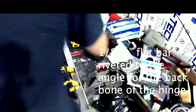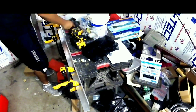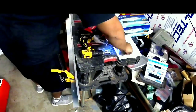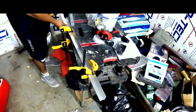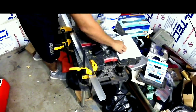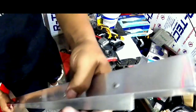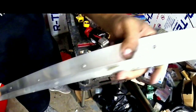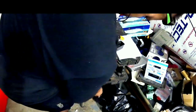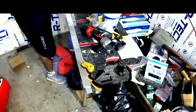Now we work on the hinge, which is its own big monstrous thing. I apologize for the giant mess in my garage — with limited time I have to choose between cleaning or cranking out this boat. Right now we're making the rod locker and side stow hinges. We're taking an inch and a half by one sixteenth angle and riveting a two inch by one eighth piece of flat bar to it. The one eighth inch piece of flat bar, when held vertically, is really hard to bend. That hinge is going to be able to free float out there with minimal support, stand alone, and not flex when stepped or sat on. On the last little half inch, we are going to attach a piano hinge, and we're pre-drilling the holes to mount it — an inch and a half long aluminum piano hinge.